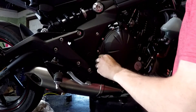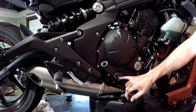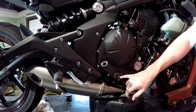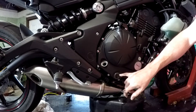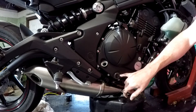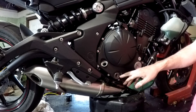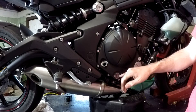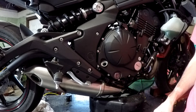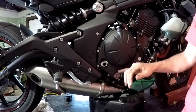The most important part of this oil change — you have to put oil in the bike. The oil fill is up here, and your sight glass is right down here. There are two sets of lines: one set here and one set here. You want to make sure the oil is somewhere in between these lines — this is the absolute max and this is the absolute minimum. Always make sure it's as close to the top as you can, on a level surface. It's always a good idea to periodically check your oil level before any long ride. Nothing would suck more than your engine seizing because you never checked your oil — it's very easy and very preventable.